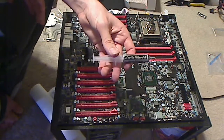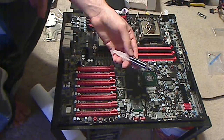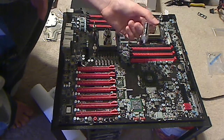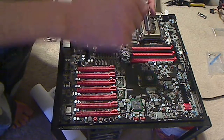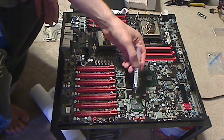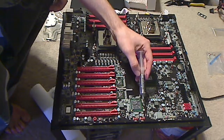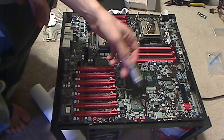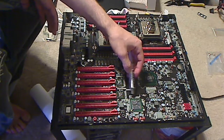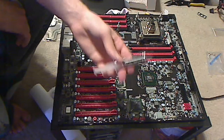What this basically does is fill in the micro gaps so that you get better contact. This goes for anything, same thing with CPUs. There are lots of different debates on how to apply thermal paste — sometimes they say to do it in an X, sometimes a big glob in the center. Some people get a razor blade and finely comb it over. I kind of just put a glob in the center for small ones, and for others I make an X pattern and then another X inside of that. As you can see, I've drawn one X and then a cross in the center — generally that's enough. The object is to cover it. Make sure it doesn't bleed over the edge onto the motherboard itself so you don't cause any shorts. This concludes this little bit — I'll start with the next step in a moment.